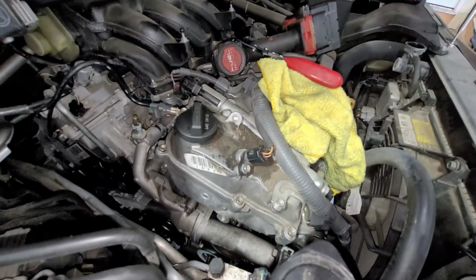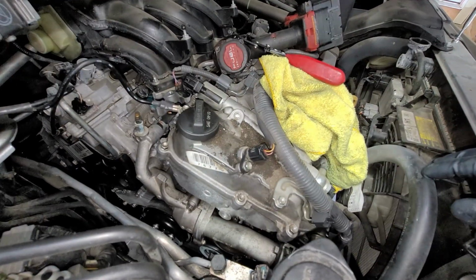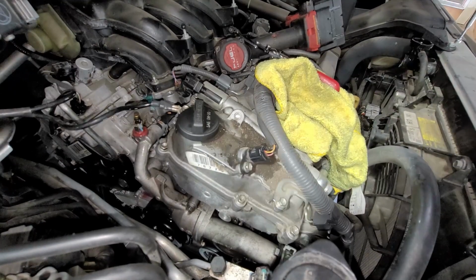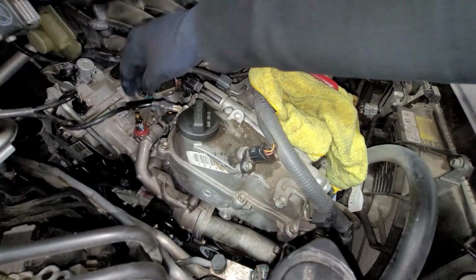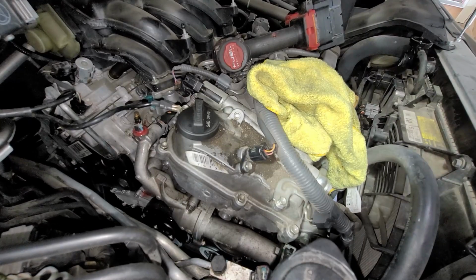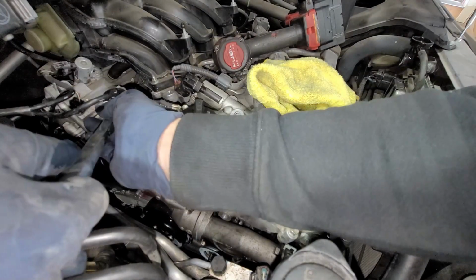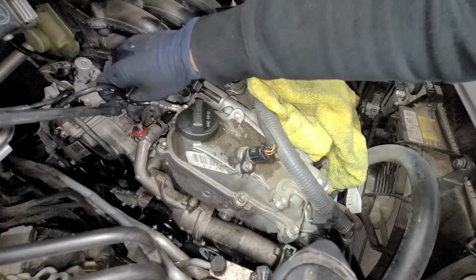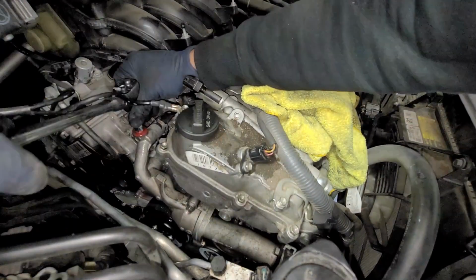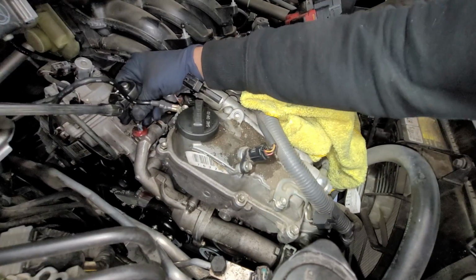So now, before we put anything else, we need to do a pressure check. So what I'm gonna go ahead and do is add coolant to the system and then pressure check it. Basically, I opened up the bleeder screw right here. That's a size 10 millimeter. And then I filled it up from right here. So that really sped up the process. So I'm gonna go ahead and close this up. I just didn't show that part, but I added 2 gallons already so far, but I know I gotta add a little bit more just because I know this system was completely dry.